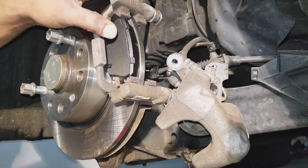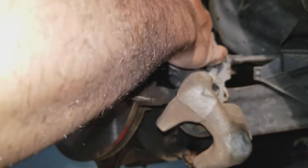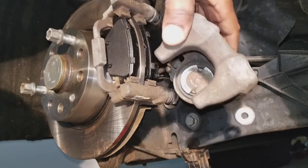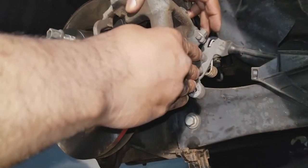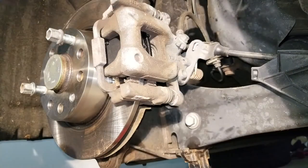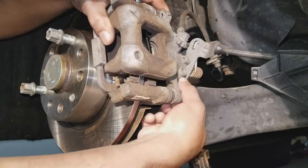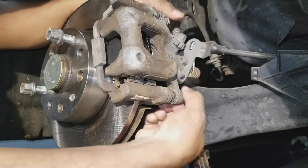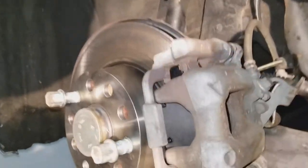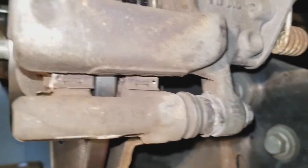They just slide right in — that's that side. The opposite side has the same notches; just slide it in place like that. Then take your caliper, slide it in place, and take your 13mm bolts. What's left is to tighten up those two bolts — 13mm with a 19mm backing on top, and 13mm with a 19mm backing down below.